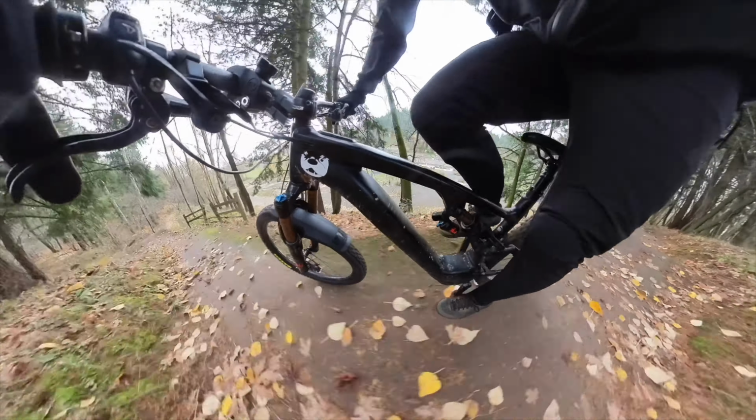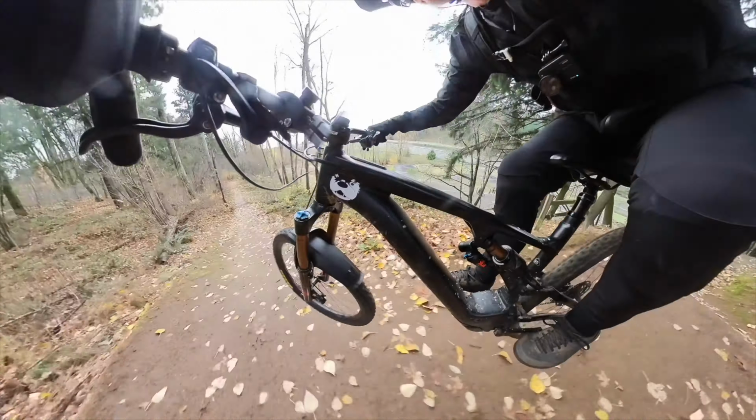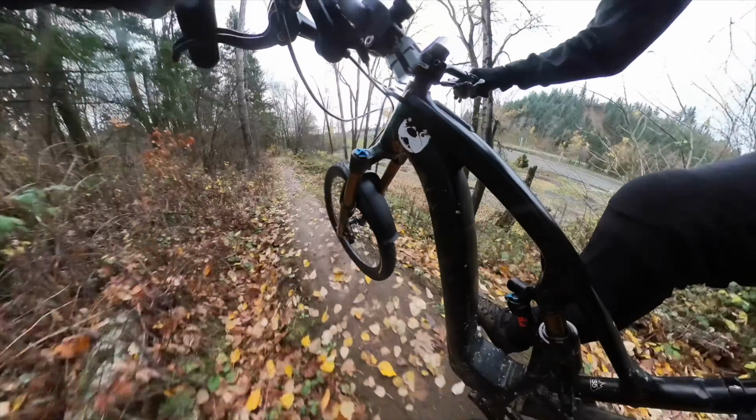Now, taking this out for a spin, the bike literally feels like it just came off the showroom floor with 29-inch wheels. Everything is perfectly balanced, manageable head angle. Arguably, the bottom bracket's a little bit too tall, but these are just blue flow trails. When you're on trail, rocky stuff, you're not going to pedal strike with a 365 bottom bracket.